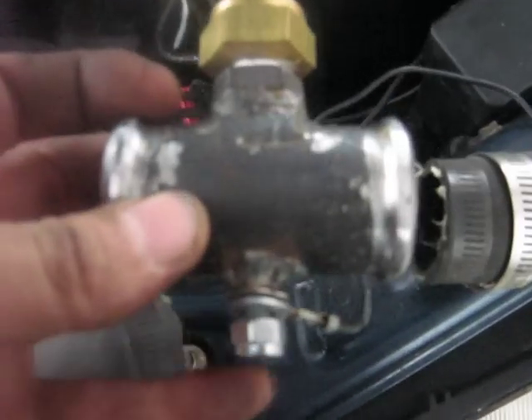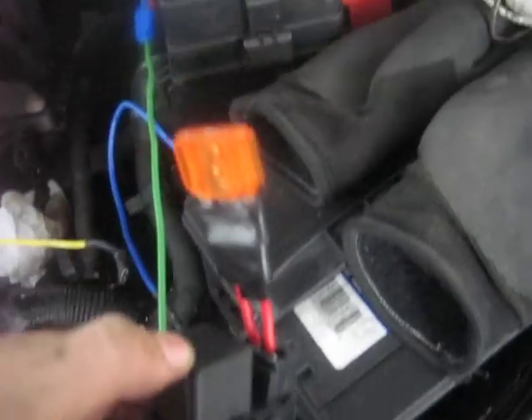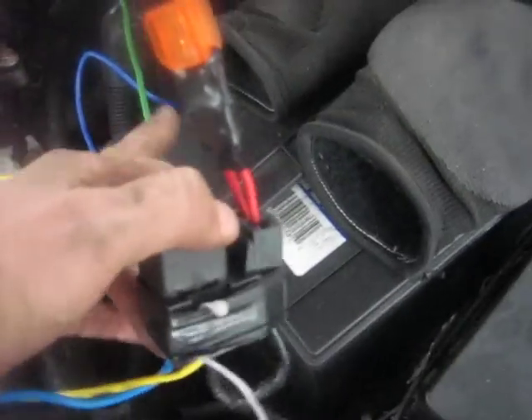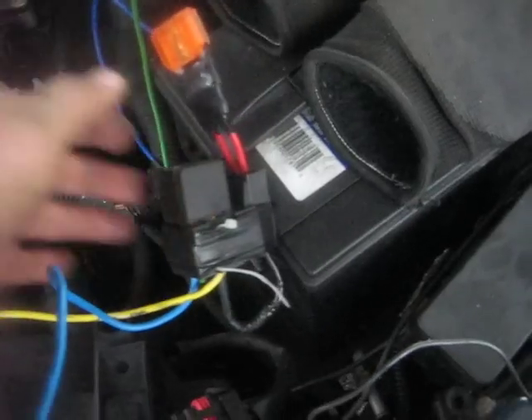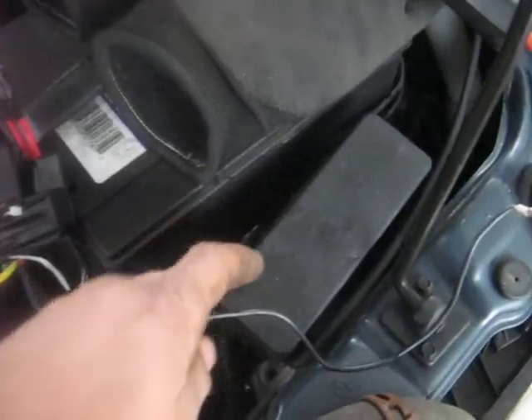You have to attach a ground wire to it — get it on the bottom. Your wire here attaches to — got the wire here — you have to hook a relay in and get it back to an ignition-switched power source. Basically it replaces this complicated, expensive fan controller.